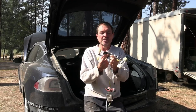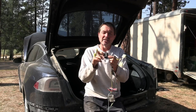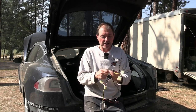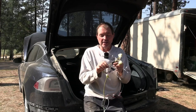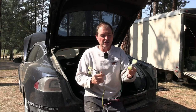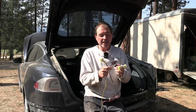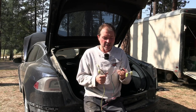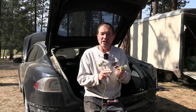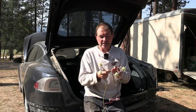These black boxes are nothing but a box to properly connect all these three wires together. So we can just snip that off. And then we have to connect. Yellow is your left turn signal. Brown is taillight. And then the other side, green, is for the right side turn signal, and then red would be for a brake light. So in our case, our brake and turn signal is combined, so we will not be using the red wire. That's as simple as that. So this will just be terminated and not used.